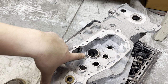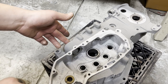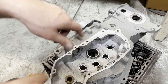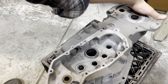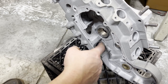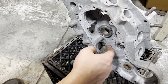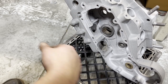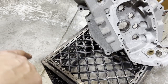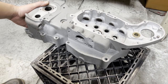You can see all the sand and all the crap from down in this cavity. I had this run through a degrease tank, blew it all out with compressed air, cleaned it up as best I could — but there's still sand everywhere because when you sandblast things, I don't care how good you mask it, it goes everywhere. So we have all this crap down at the bottom of the oil pump area. We're going to re-degrease all of this, make sure none of it got in the cam bearings, blow everything out, re-clean up the case tonight before I go home. Then I can bring it back and finish — I've got one helicoil to put in tonight and then one more on the other side.